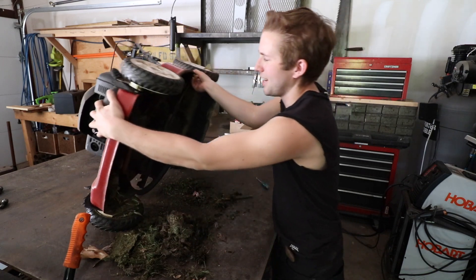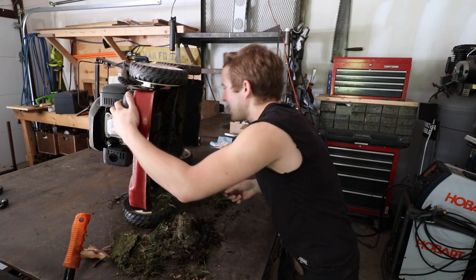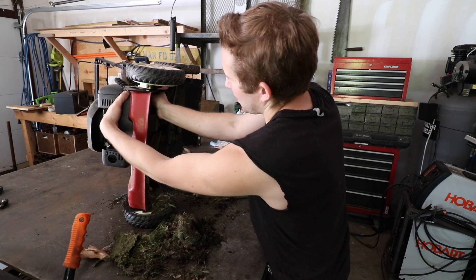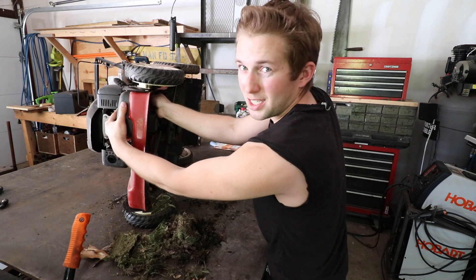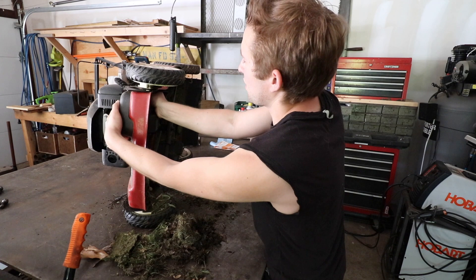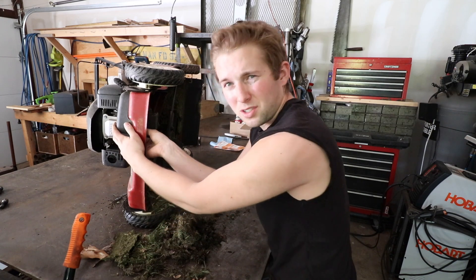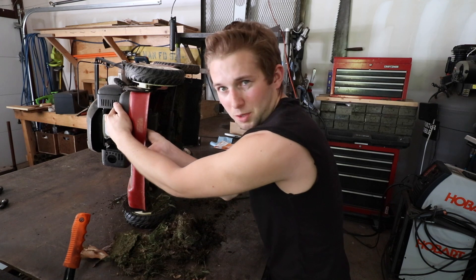Another note: if you do flip your mower on its side, just make sure the oil cap is nice and tight. After you do this, make sure you check the oil because it's possible that some oil will spill out. It's also a good idea to let your mower sit for a while and let the oil settle back down, because if you try to start it right after having it on its side, it's very likely it's going to smoke a bit — which is really fine, but I don't like to see smoky mowers.